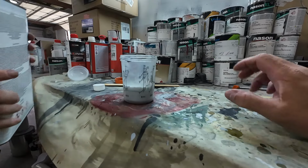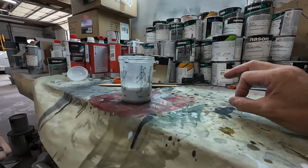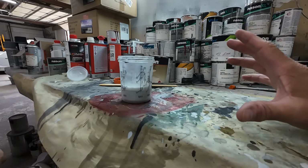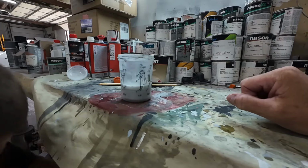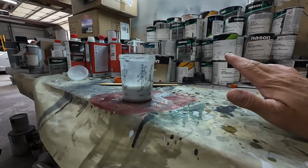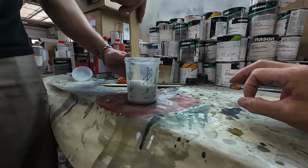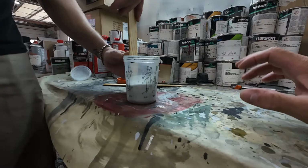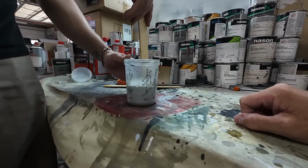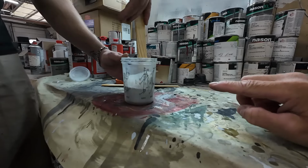Now if you were doing this at home on your own bumper, you could use an aerosol can 2K primer. I wouldn't recommend a 1K because it can react to urethane paint. So I would stick with 2K products. You can get a 2K primer in an aerosol can. I think Eastwood makes one. And I'll leave links to all the products I use in this video down in the description. This is really thick stuff, so you've got to mix it up really well.